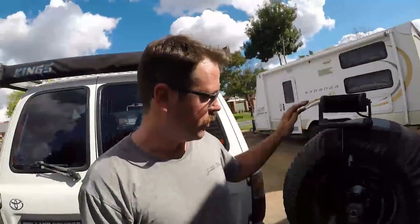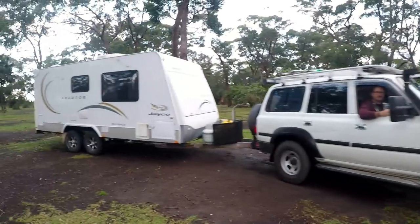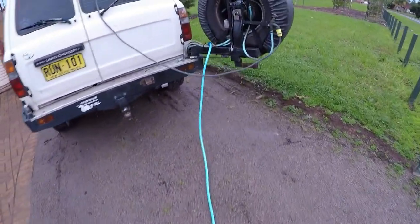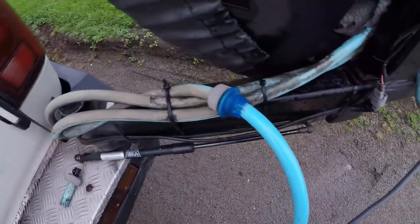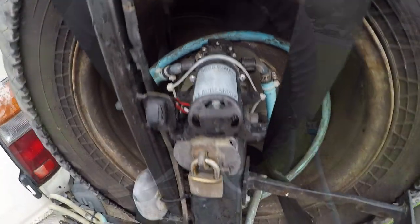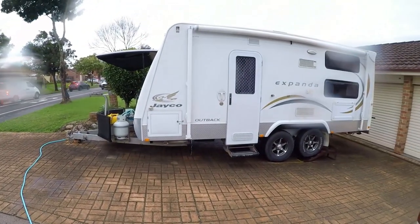What I really like about this setup is we do a lot more camping with our caravan now. We still utilise this water tank — if we're running out of water in the van, I run back into town and instead of filling up with three or four jerrys, all I do is run into town, fill it up via this hose here. I just undo this, plug straight in and pump down into the tank. I've got my breather here — it's just on top of the tank, comes out to here with an air compressor exhaust fitting. I pump in here, I've got 60 litres to bring back to the van. It's clean drinking water — I filter it coming in here and I can also filter it coming out into the van via the auxiliary filter we've got for the caravan.